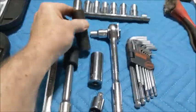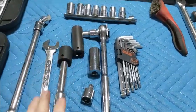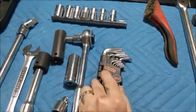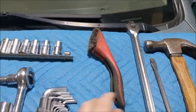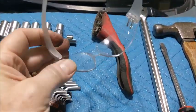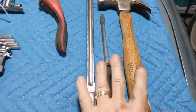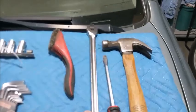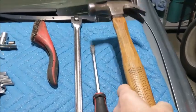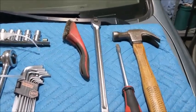There are deep well sockets — six-point versus twelve-point. If you can get away with a six-point you get a much better grip, and I might need two of them. One of the pieces is going to need an allen key wrench to hold one of the nuts. It's always good to have a wire brush to clean off your parts and get your sockets on properly. Always wear safety goggles. I call these the persuasion pieces — sometimes you need a breaker bar for leverage to break loose rusted bolts, and sometimes a hammer helps in conjunction with the breaker bar to snap a bolt loose.